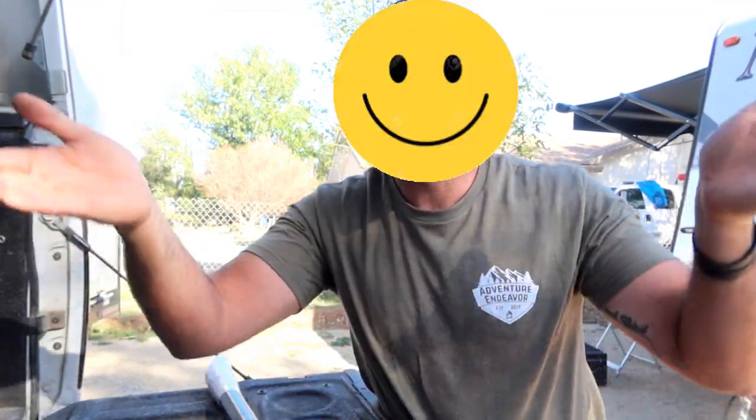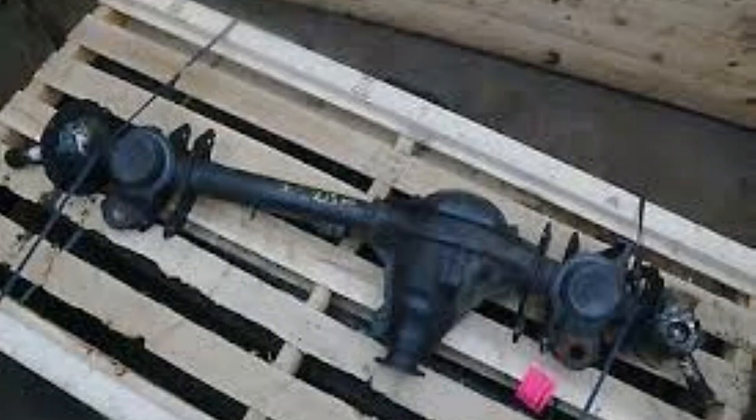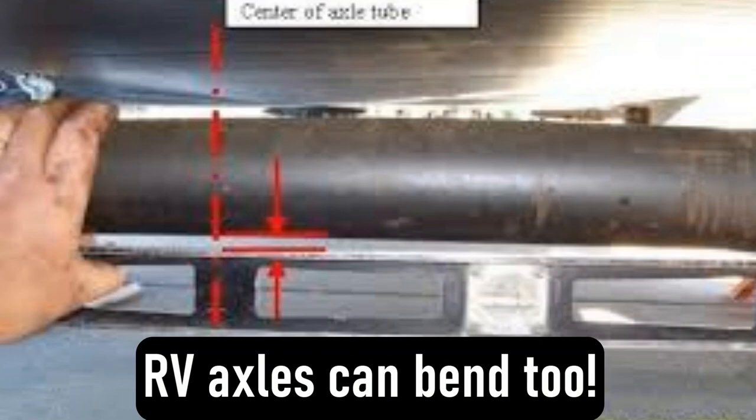This is something I've been putting off for a while. Basically you want to install this axle truss made by Thurn Fabrication — we'll link it below — to prevent your front axle tube from bending; you don't want it to be a smiley face. Believe it or not, with how heavy this Cummins turbo diesel is, when you're going through a whoop section your axle is teetering up and down. That heavy weight pushing down through the springs into the center of the axle slowly over time starts to smile your front axle. It's a pretty common thing in the pre-runner and rock crawling world.